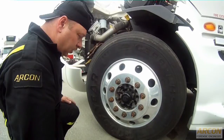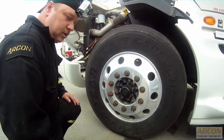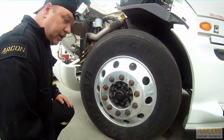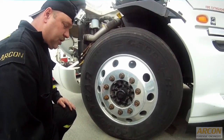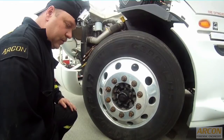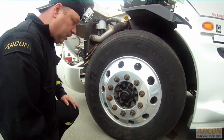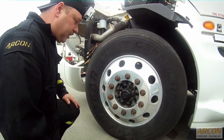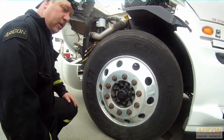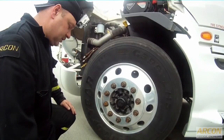You could lose a wheel or cause a fire due to overheating of the bearings. So in the case that we have a wheel off situation — trailer loses a set of tandems, hits a car — the circle check is extremely important to recover that document and to analyze any statements from the driver about what he does during his circle check. Because the oil level — there's less than a coffee cup worth of oil in there — and if he was just relying on his experience that he's going to see oil because it's leaking, by the time he sees the oil, it's too late.